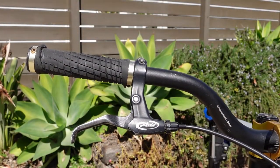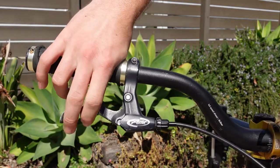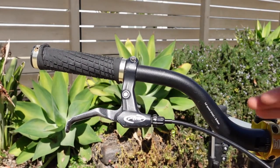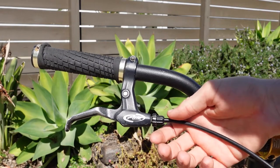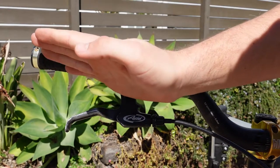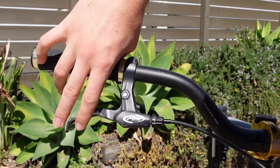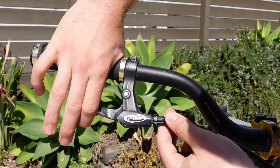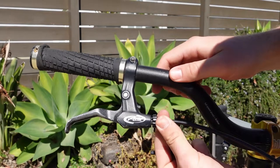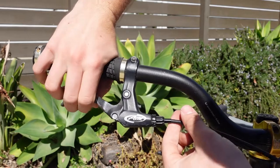Our last step is to come back up to the lever and see how we did. Mine's pretty tight, looking good, and it's not rubbing in the back — the wheel's still spinning well. With barrel adjuster adjustments: if you screw it out, it's going to make it tighter, meaning your lever is going to come out more. If you screw it in, it's going to make it looser, meaning your lever will go in further, closer to the bar. Mine's pretty far out right now — that's why we left a little bit of space and had you click it out a couple of times. I'm going to go in a couple of notches.